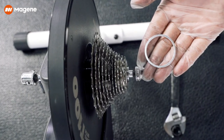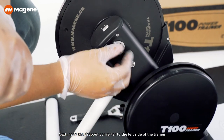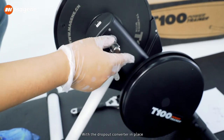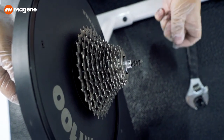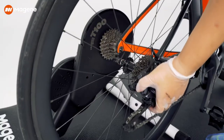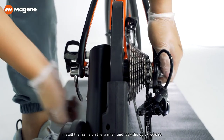If you are using a Shimano 10-speed or lower cassette, put the cassette spacer onto the freehub body before installing the cassette. Then use a cassette lock ring tool to lock the cassette locking ring. Next, insert the dropout converter into the left side of the trainer, paying attention to orientation depending on your bike's dropout width. Insert the quick-release lever from the left side and place the conical springs on both ends with pointed ends facing inward.